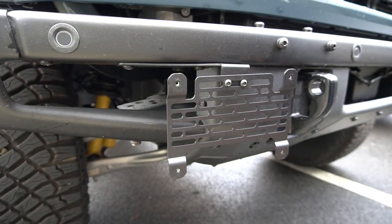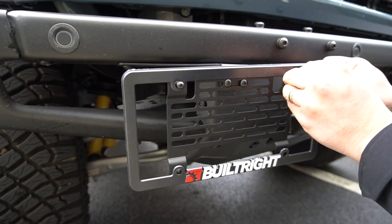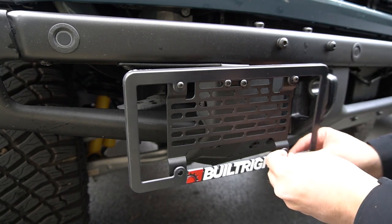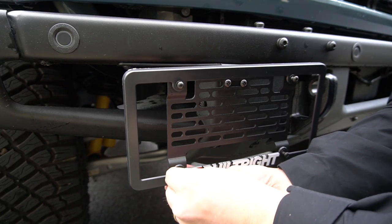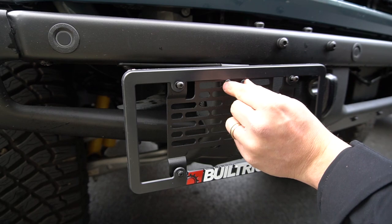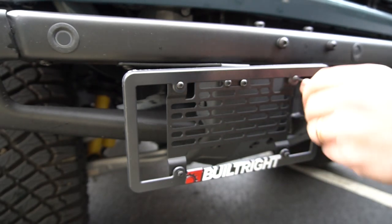We've got our backing plate on. Now the final step is to install the license plate — I'm going to skip that just so you have better visibility. We'll get these three millimeter head screws started; you may need your allen key if there's a little powder coating in the threads. I typically get all four started loosely and then tighten them down. Before tightening, take a step back and make sure the plate is exactly where you want it, because once cinched down you need to remove the plate to access the two bracket mounting points. You can still make angular adjustments from the bottom with the plate installed. Once you're happy, tighten them down and installation is complete.